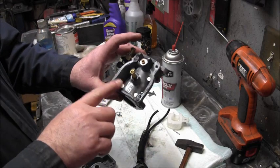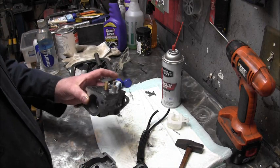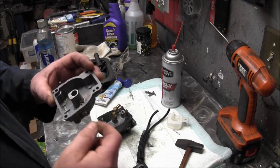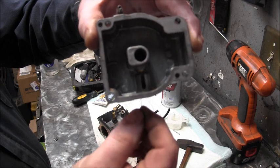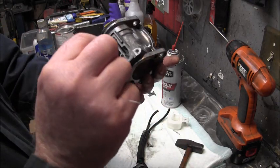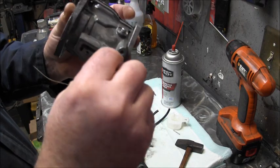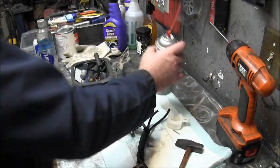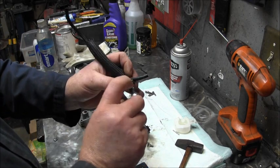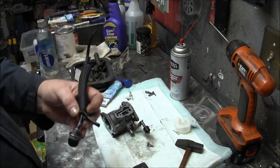Okay, so I took me a little Vaseline and put on here. I didn't even put this in the ultrasonic cleaner. I just took it and blew it with compressed air. And then I took my little wires, my guitar stringies, and I put them in there, and I can see them. I don't know if you can see it, but squeaky, squeaky, squeak in there. Then I went to the transition chamber, got these real small wires, put in these little bitty holes. Squeak, squeak, squeak. And then I blew that out with compressed air. Little can carb vapor cleaner, and I'm ready. Took the Tri-Flow and put the little squirt plastic thing in there. Gave each a squirt, and then I blew it with some compressed air. So hopefully that's going to work.